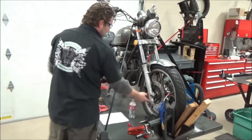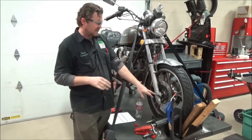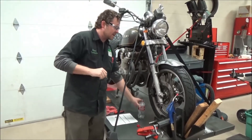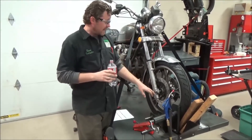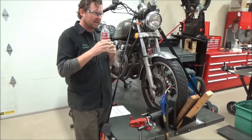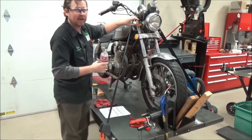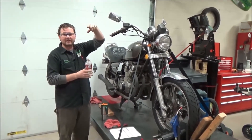In a metric vehicle I had never seen any orientation specified either, so when I heard this story my curiosity was really raised. The story is this: somebody at Harley figured out that by having that hole facing up, the wind was coming across it, resonating into the chassis, up into the fairing, and by the time it reached the rider they were hearing a whistle. It made a lot of sense because the tone would change with how fast you were riding.